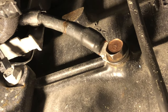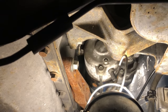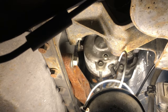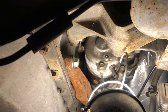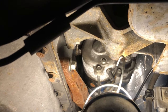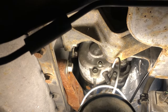We got the starter back on her, and I had a feeling this thing was going to fire right up. I had a 2004 Dodge 1500 series that was doing the exact same thing about eight months ago — the guy had it towed to me. We had the exact same issue, and right on the front of the engine block there was a ground right there. We cleaned it and it started just fine afterwards. So these grounds seem to be a problem.